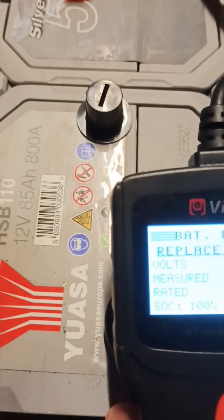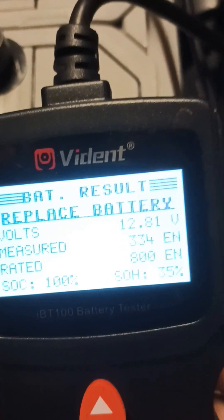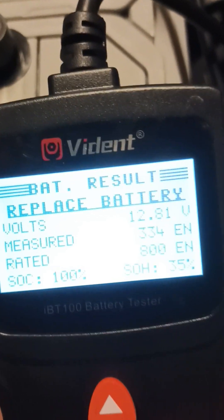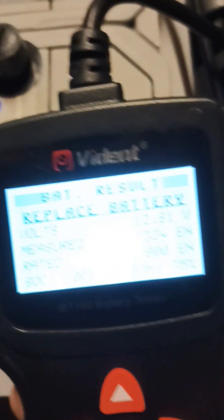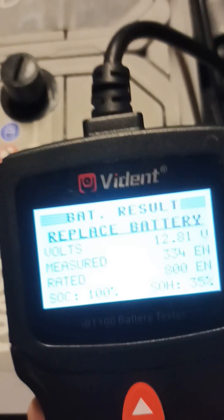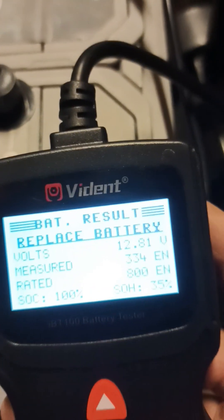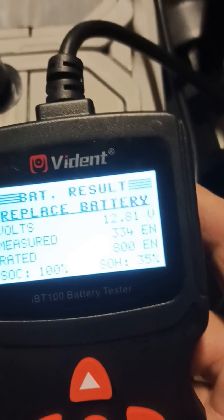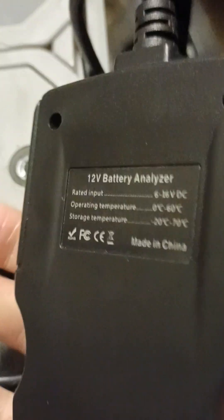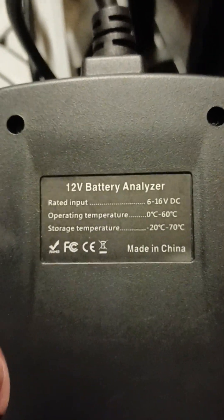So it's pretty useful, it's pretty instant, and it really does test the battery. Not like if you put a normal voltmeter on and think, oh that's alright, it's 12.81 volts, that's fine, stick it back in the vehicle. No, it's no good, and that's after fully charged — it was over 13 volts when I put it on there, so it's fully charged. It's pretty useful, a very simple thing, not that expensive. There's all the detail to it.